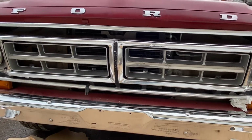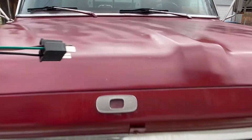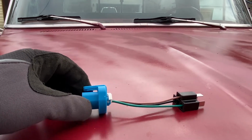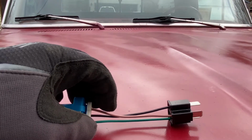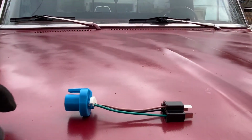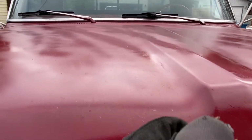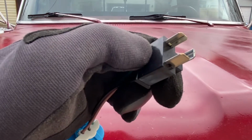I'll put all the part numbers and such below in the description, but if you pick this up from LMC Truck and they send you this pigtail connector deal, just know, depending on your bump side on your pickup, you may have to switch the orientation of these two around, and I hope that this video helps. Again, it's quite easy, just relieve that pressure and that tang on both of those.